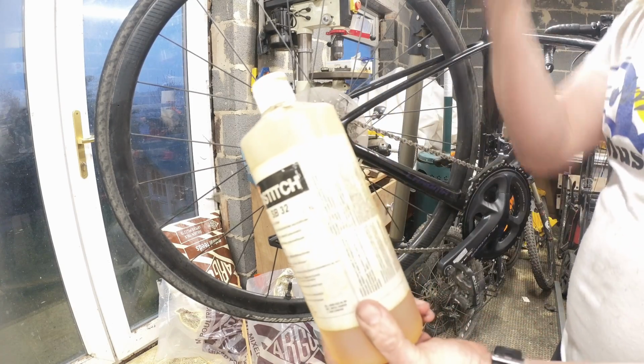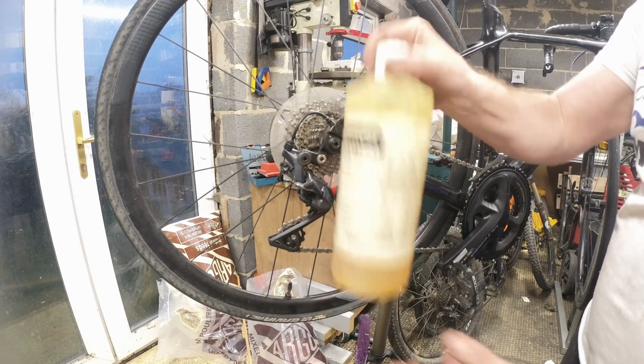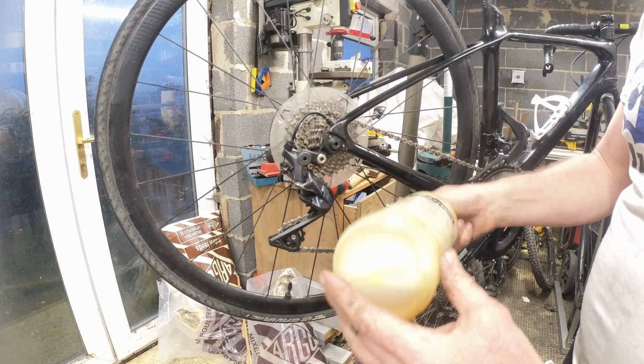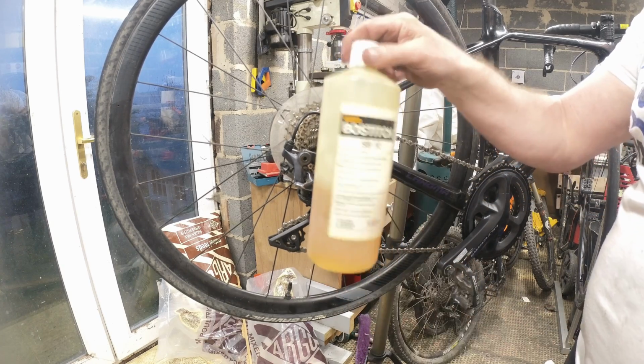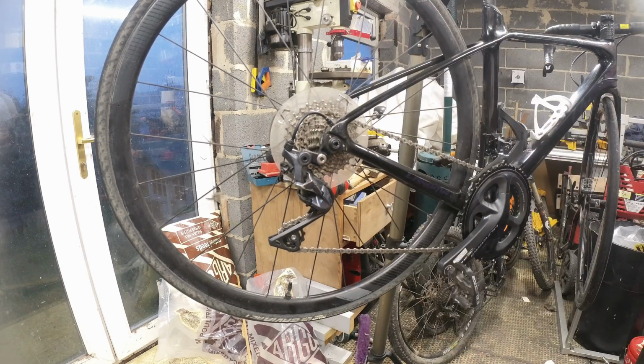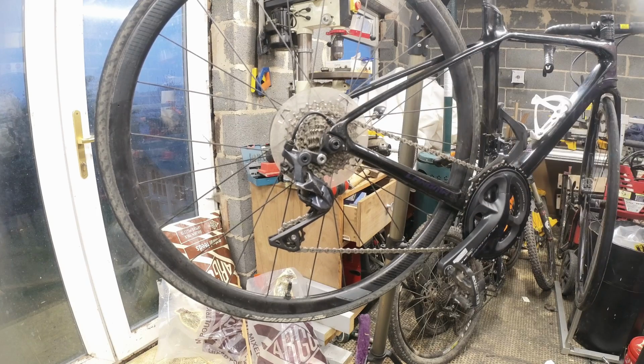Like a nailer or a ratchet gun, you put a drop of this down the airline. So if you've got an air system for your tools, you have an inline oiler. That's the oil that goes in it. It's just a very light 3-in-1 oil. So that's all you need. And you know what? If you're struggling, just a bit of WD-40 on it, and that'll actually dissolve a load of rubbish before you put the oil on.